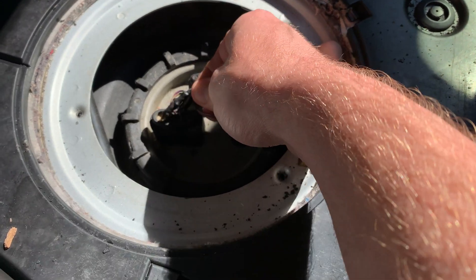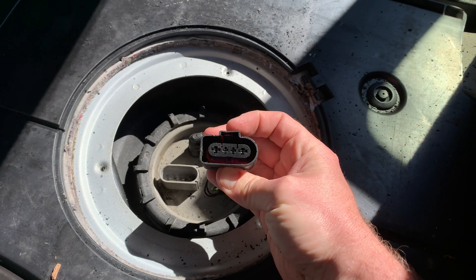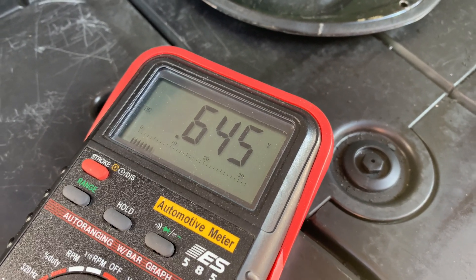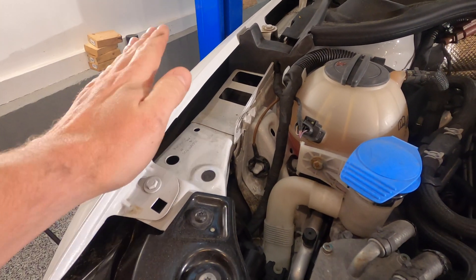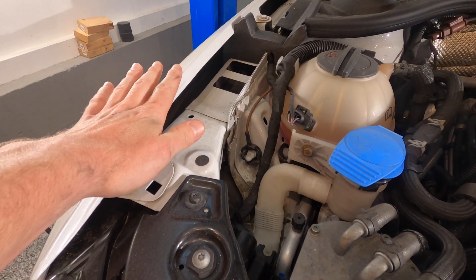That's a really easy example. So let's say someone tells you to check the voltage at the pump — what do you do? This lift pump has a pretty sketchy-looking plug; it looks like it's been repaired before. I'm going to check for power by putting the leads in the outside pins, one of which should have power and one should have ground. Turn the ignition on and nothing — this plug is dead. There is no power at the pump. Now this assumes you know which pin needs to have power, so hopefully you have a wiring diagram. If you're trying to measure voltage, you always have to have the negative lead on a good ground — the whole chassis of the car is grounded, so most of the metal will give you a ground.